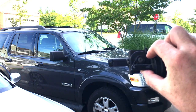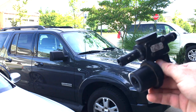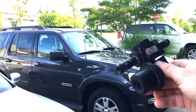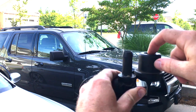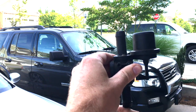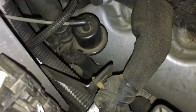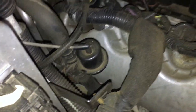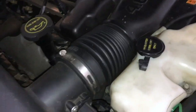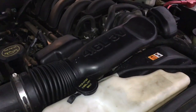The parts haven't changed much. They're still cheap, made out of plastic. The old one may have had four hose lines instead of two, but it just sits in there like this. This is the old one — vacuum line connects there, the J hose goes there, and the heater hose we're replacing goes into the bottom. There's a section that also goes lower, so we'll have to replace that hose too. Part of it will be done from under the car and the front part from the top. Then we'll have to bleed the cooling system after that.